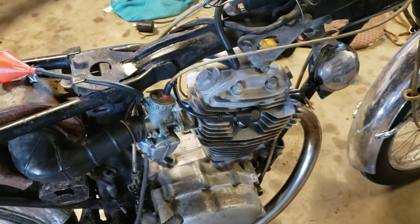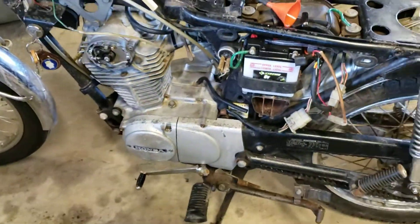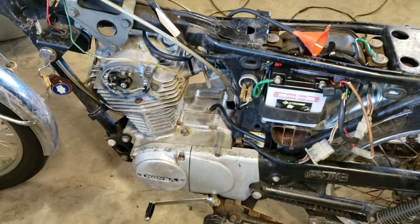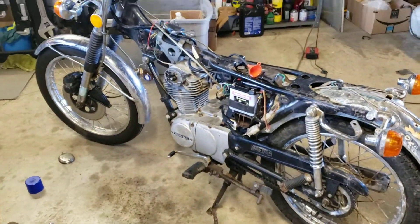With a little bit of adjusting on the carburetor — of course it hasn't run in years, so it hasn't even got warmed up yet — I think I'm going to advance the timing just a tiny bit and we'll see what happens. It should fire up first kick after I get done with it. So that's the first run.